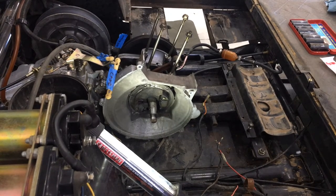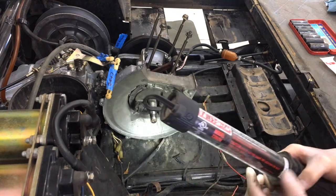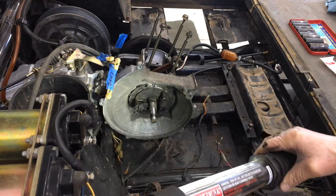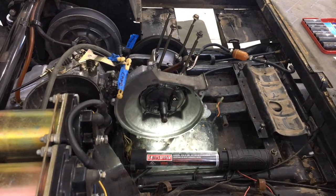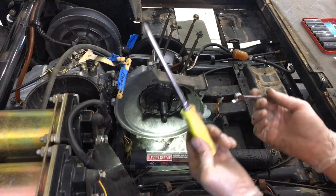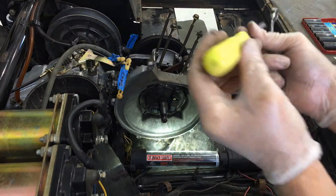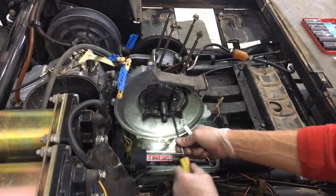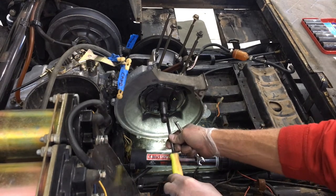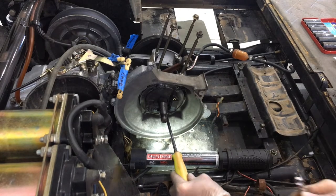We'll go ahead and unscrew those. I think we're going to have to unhook this wiring harness down here, and there's a grommet back there, so we'll need to feed the wires through to totally remove the stator. Both screws came out with relative ease. My screwdrivers have a place to put a wrench for better leveraging. Down in this lower position I'm pretty much against the frame where the battery sits, so I don't have a lot of gripping potential.